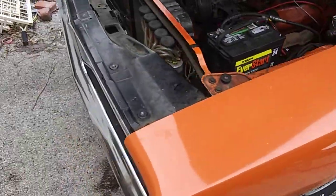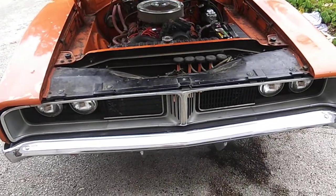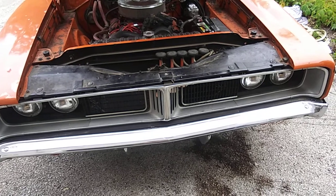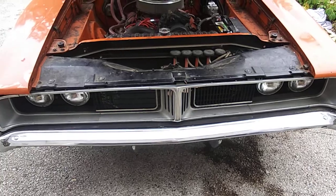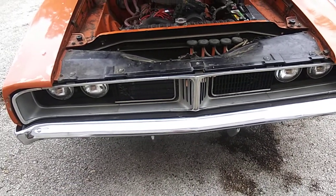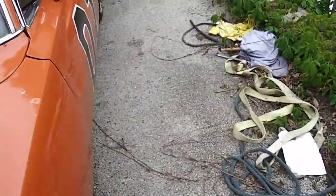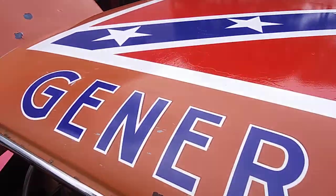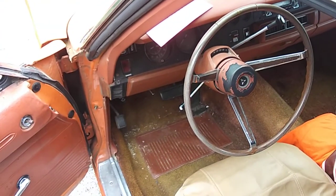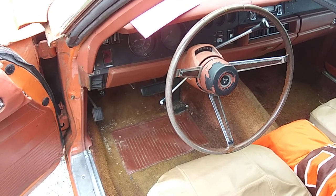He was also having some issues with, I think he burned out a headlight or two, and he didn't have any headlights or anything at night. He had taillights, whatnot. Replaced the high beams and the low beams today, and then came in here and replaced the dimmer switch. Looked like the dimmer switch got a little hot. The plastic fitting that goes around the three prongs was a little melted.